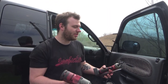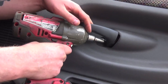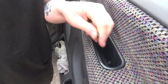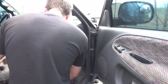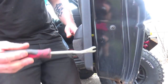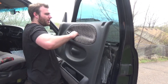You need a couple tools to get that door panel off this second-gen. We got a Phillips bit number two, an actual pry tool, and a 10-mil socket. The first thing we're going to do is get the actual door handle off with the 10-mil. Just like that, the door handle comes off. Then we're going to get a couple Phillips screws out of the way — two right here in the handle, and one up here by the mirror itself. Then we take our pry tool and start working around the door. You peel it back and you can see the yellow clips. Get your fork tool behind there and pop it out. After we get all our door panel clips removed, we can just lift the door panel straight off.